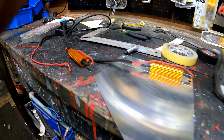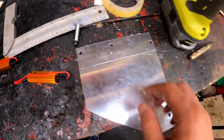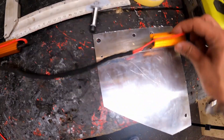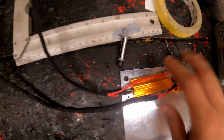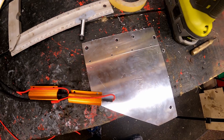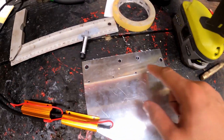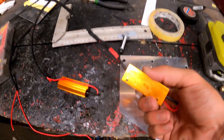Super quick update because my battery is about to die - my boost pipe actually runs into where this plate would go as marked up, so I'm going to cut it off here. That means my resistors are going to line up like that. I actually just needed the template for the holes rather than the size of it. I'm going to run this through the bandsaw, chop it out, and as soon as it's out I'll put some thermal compound on, put these resistors straight on, and then rivet them.